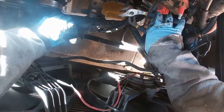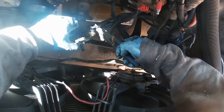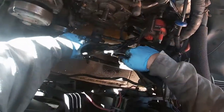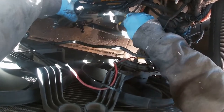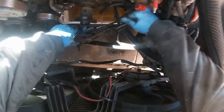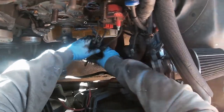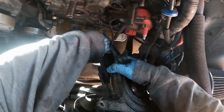That looks pretty bad. There are two vents down here — this is to get the gas out. On these earlier model OptiSparks they didn't have vents, and on the Camaros and Firebirds they get so hot it was like gas was forming in there. That's what was also killing a lot of the early OptiSparks — like the '92, '93, '94 — they're gear driven.